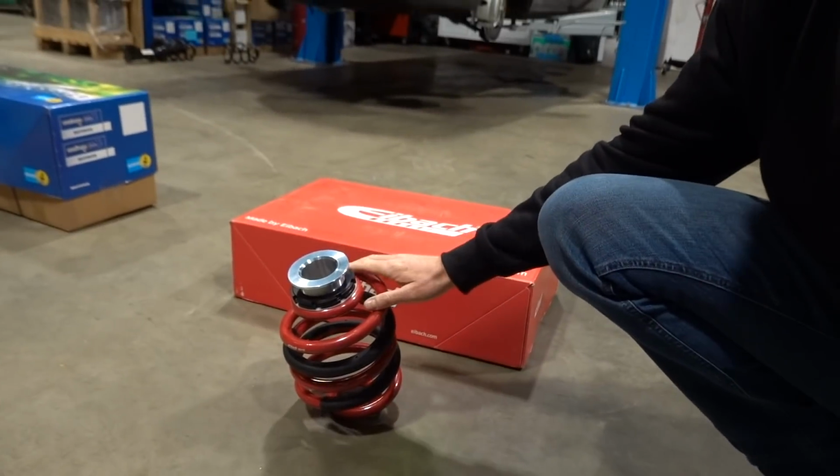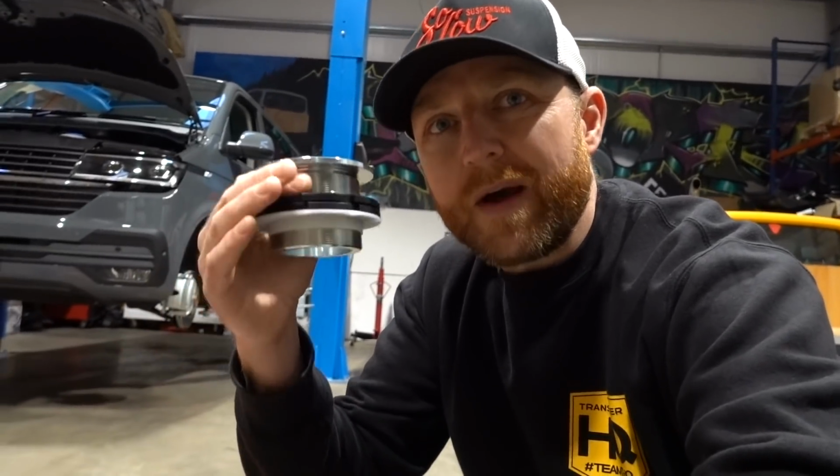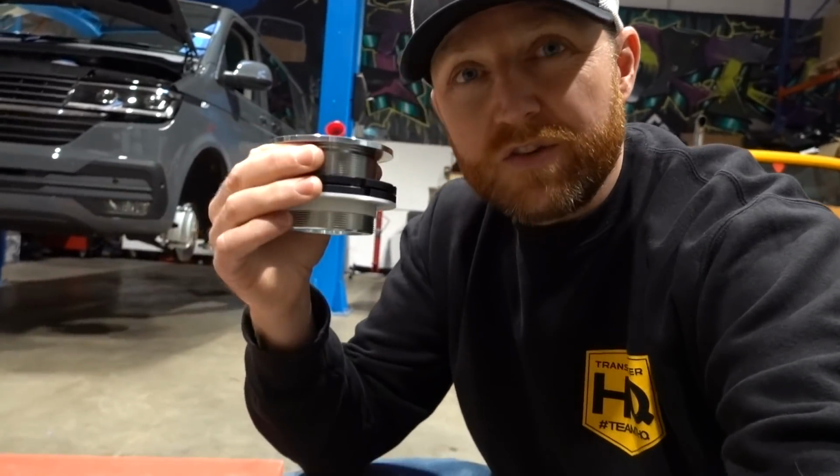And then you fit the rear springs like this one, which has an adjuster on it. So you can then use that adjuster to adjust the back of the vehicle up to the height to match the front. That'll improve your handling anyway. It'll make the vehicle sit nicer, it will drive nicer. It will handle better because the weight's balanced. So that's your first option.